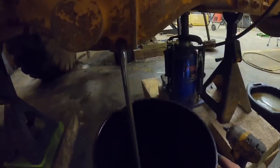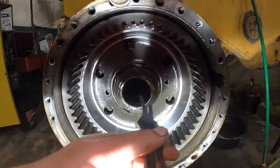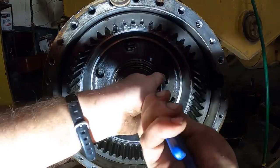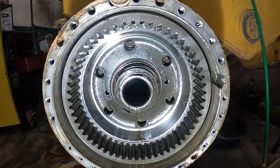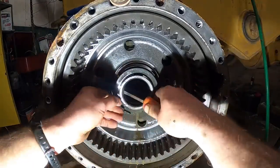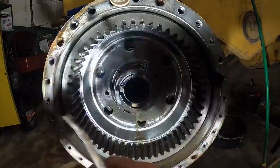Oh man, I did it again — I'm going to be fishing for that later. Let that drain down and we've got to get some wheel bearings busted loose. Next thing I'm going to do is get this axle nut off here. Looks like it's got a snap ring retainer — hopefully I've got enough pliers to get that off there. I did get the snap ring off without hitting me in the face. We're going to lay it over here on a piece of cardboard. Next I think it's like a little thrust bushing here — it kind of pops right out. I'm laying this stuff out in the order it comes off.